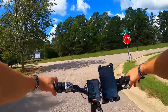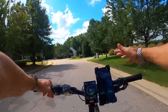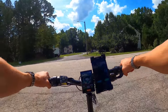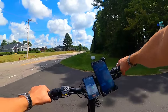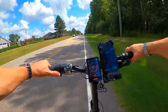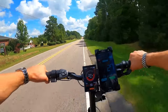Alright, we're about to do a top speed run. Battery is at 53 volts — it's a 48-volt system so we're well charged. To hit top speed on a mid-drive: pump up your tires so they're nice and firm, lock out the front suspension, have the battery fully charged, and slowly build up through the gears. You can't just hit top speed in two seconds — start in four or five and build up to eighth gear. We'll put it into pedal assist 5, hold down the plus sign for a few seconds to put it into sport mode. There's some traffic but we're off and running — shifting up through the gears now, getting to seventh, then eighth. Let's give it full power.